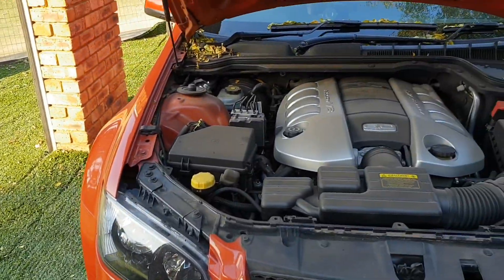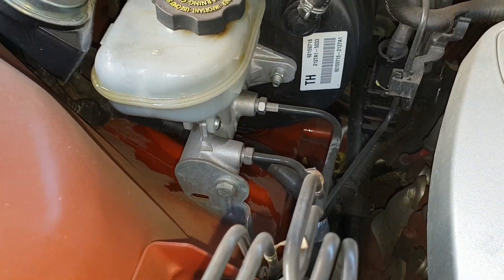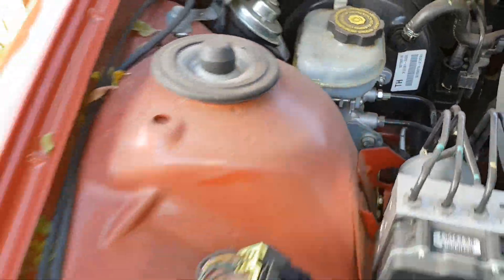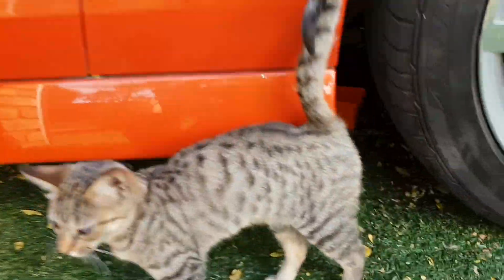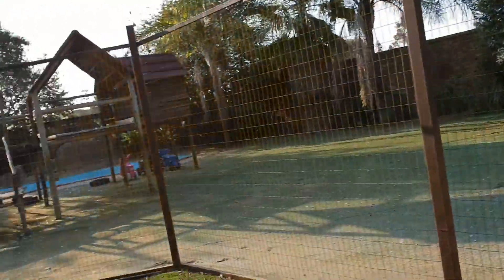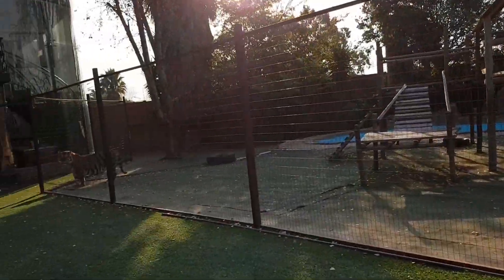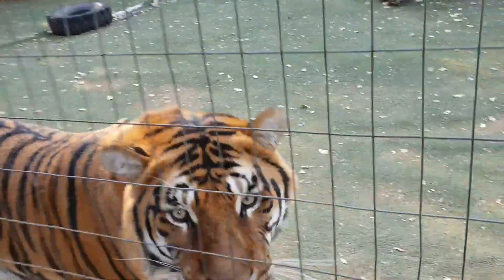Little Opal — there she goes, just running around, and we're done. Going to have to clean up that brake fluid over there — that's one thing that happens when you push those pistons back, it overflows a bit. Still got the bucket underneath — I caught most of it, but I'm going to have to clean it up perfectly, because when it rains all of that oil will float on top of the water and you'll have it everywhere, and that might just make this place really slippery. So you really have to clean it up.